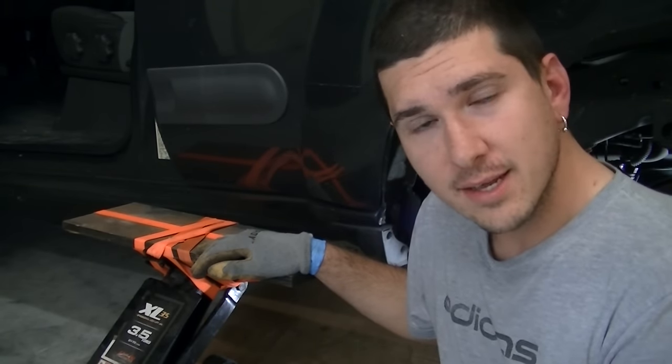If you're going to be storing this for a few hours up to a day while the pump is out, just find something to cover it up. I'm just going to take a bag and put my O-ring gently back on so that nothing gets into the tank while it's sitting. Once the pump comes in, we're going to reassemble it and put it back on the truck.